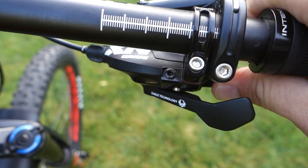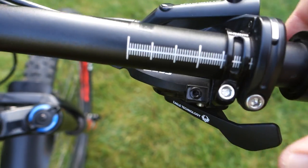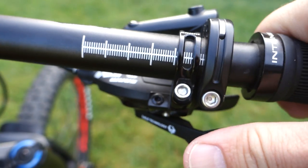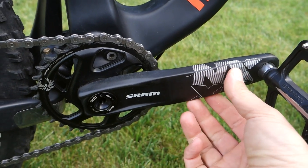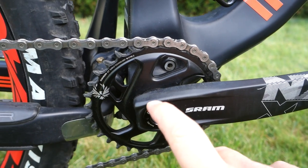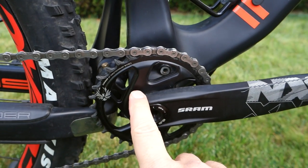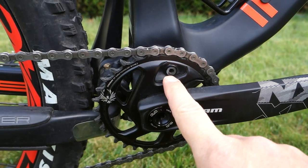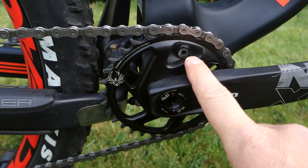I can't really feel the flex in the paddle. However, if you want that double upshift that Shimano offers, you can just cleanly replace this shifter with a Shimano 12-speed shifter and that will work just fine. Cranks are very similar to the GX or SX cranks for that matter — they all use the new DUB bottom bracket. And the chainrings, X-Sync 2, are again the same.